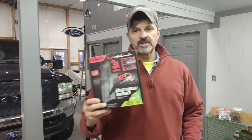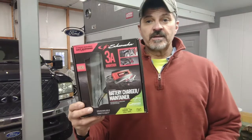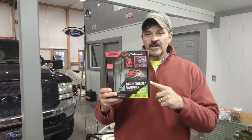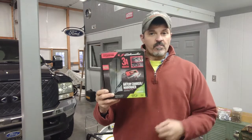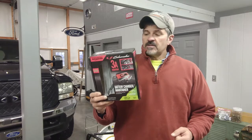I'm back — I apologize, but my battery went dead. I found out that the Schumacher charger's battery terminal would not fit my battery; they need to be bigger. The charger I purchased is the Schumacher 3-amp maintainer, model SP-1297. The identical John Deere version is exactly the same other than the emblem. I bought this off Amazon for $39, while the John Deere one is $69. I've got it hooked up now but I'm going to show you what I did to make it work — I added some length of wire.